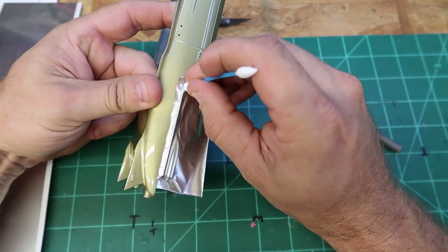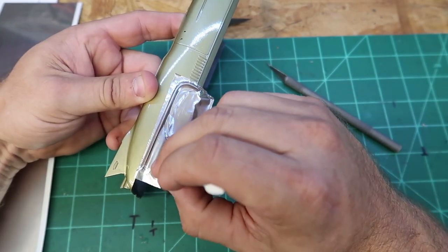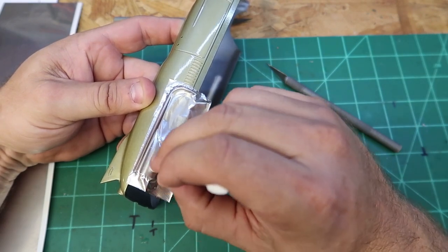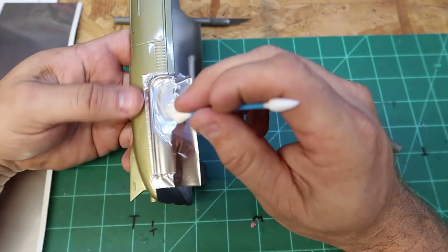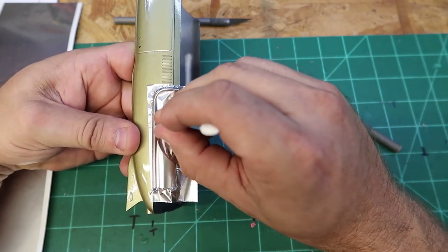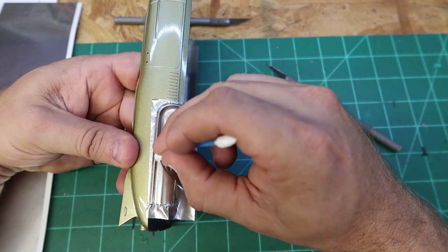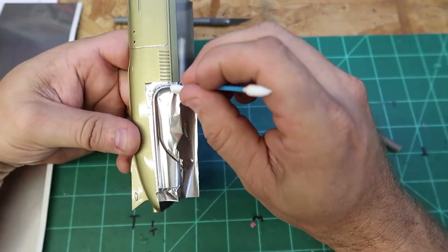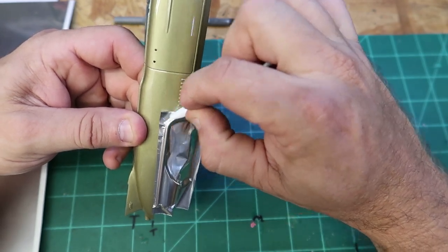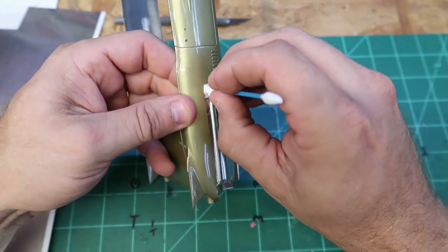So there's the trim around the fender and then this rear portion behind the rear wheel. You can get bare metal foil to flatten out even if you've got a crease in it, and you press it hard enough. It also will rip if you're not careful. Press around the edges. As I start to press, it will stretch. It's metal, but it will stretch. See, if you press around those edges, it will start to conform to those edges for you, so you'll be able to cut it. But you'll get some wrinkles, but if you just keep pressing, generally they'll come out.